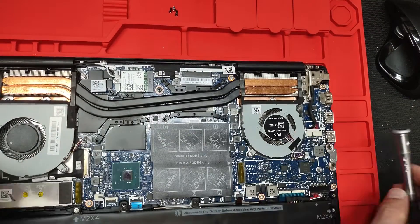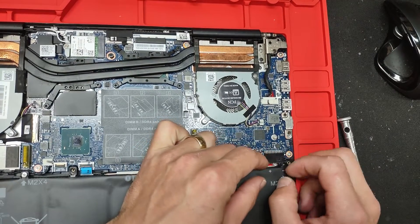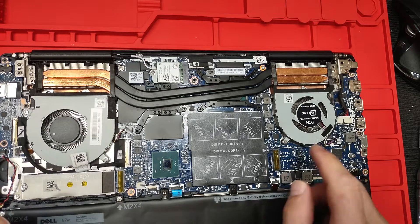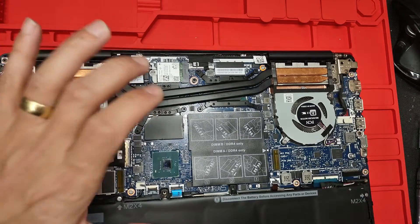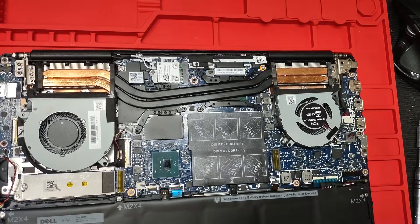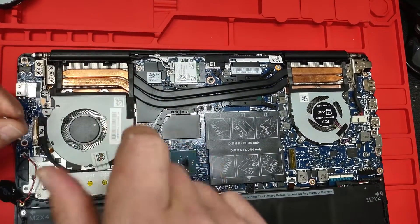So these are the fans. What I would recommend, just as a precautionary thing, just remove the battery connector. You have the left fan and the right fan — before you start to work, pick up your fans and make sure that they are the same size and same type of connection. On the right side of the computer you have the CPU fan, and on the left side of the computer this is the GPU fan. In this particular one the GPU fan is damaged, but it's better to change both of them.